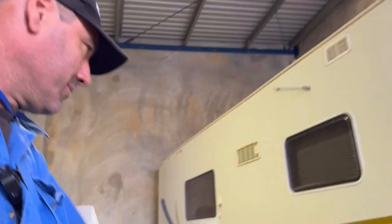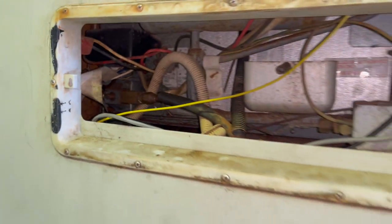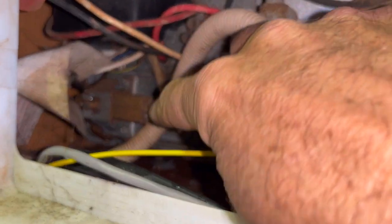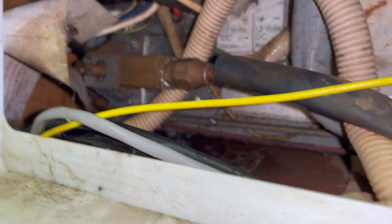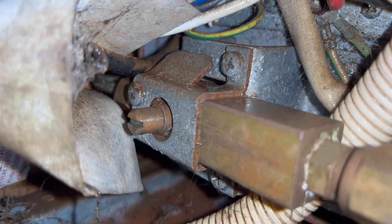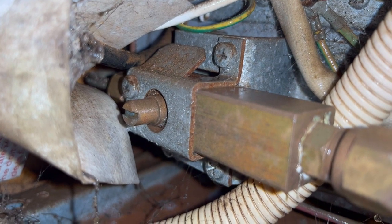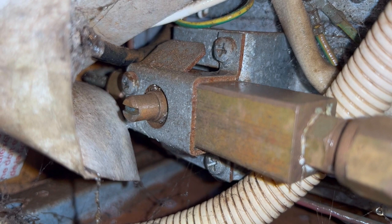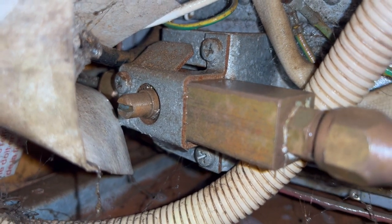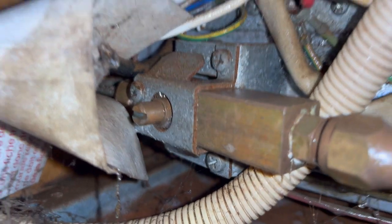This is the kind of thing that just blows hours because you've got to try and find it. The door over here was glued on because it was missing the little screw. This is the fridge line here and this is where it comes in. I thought it could be this fitting here, but when I sprayed a little bit of water around it, you can just see - there's a slight little leak on that inside the fridge. It's so small, so minute, but unsafe. The only thing I'll do is just isolate the fridge.